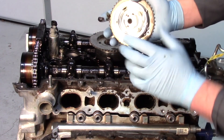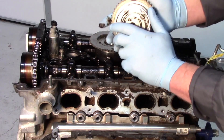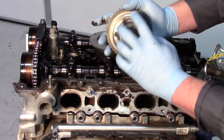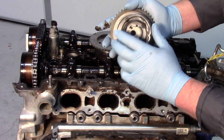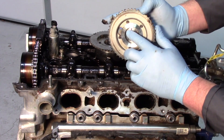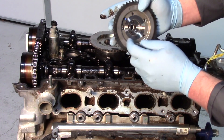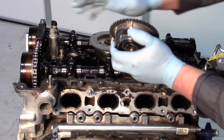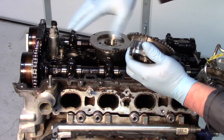If I had a little better grip here, you would see I'm able to decouple and move from the sprocket the gear part, and move the part that's physically attached to the camshaft. If we look on the back side, you'll see a little alignment dowel that goes inside on the camshaft. These two pieces decouple and cause our cam advance or retard.